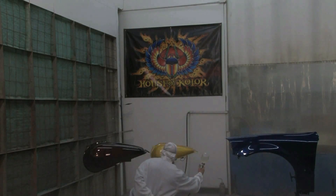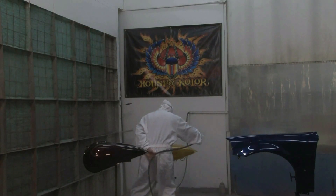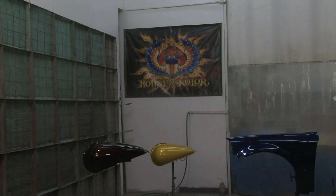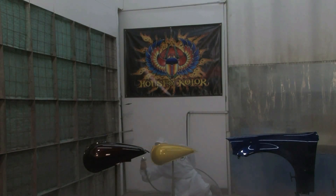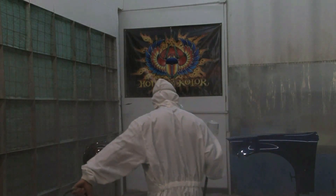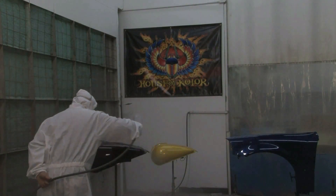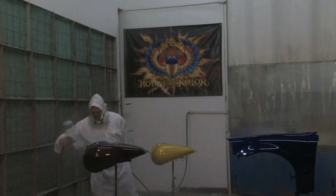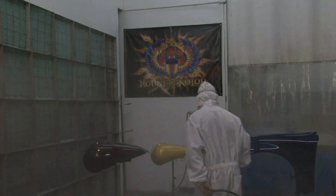Look at how beautiful that blue looks — even under fluorescent lights, which always kill a good-looking paint job. On the first coats of clear you'll notice that yellow tank rainbows with a halo that follows you around, especially with that effects pack. Always keep an eye on your hose and what it's doing — it can get you in a lot of trouble. 50% pattern overlap, straight line thinking. This should light up this candy job. Lots of depth there. This clear, because of its high UV content, protects the final finish so it'll hold up in the sun.